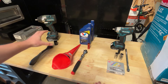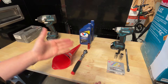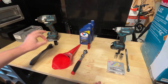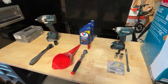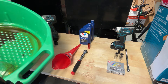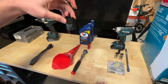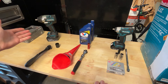The first thing we're going to do is change the rear differential oil. You really only need a couple of things to do this — it's not complicated at all. I'll have a link description for everything you're going to need and all the fluids too. I definitely recommend you have gloves for all three of these jobs. There's a mid-torque impact wrench here — both my bolts were pretty stuck on there and I had to pull the impact to get those off. The mid-torque took them off no problem. For any of the fluid changes, you're also going to need some type of fluid reservoir to pour all the fluid into. I've got a nice little fluid pan that works really well. For the rear differential you're going to need a 24mm socket and a half-inch ratchet. I used a mid-torque to just pop off those bolts, no problem.